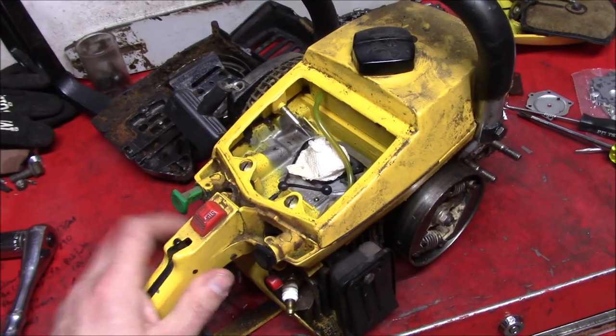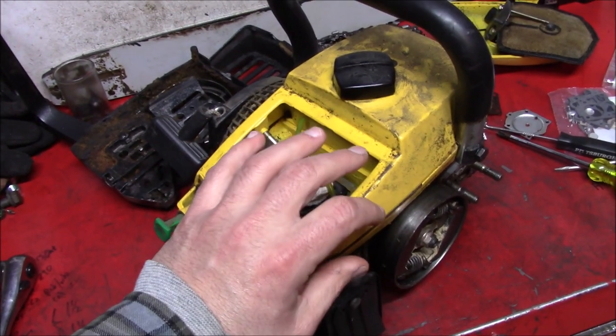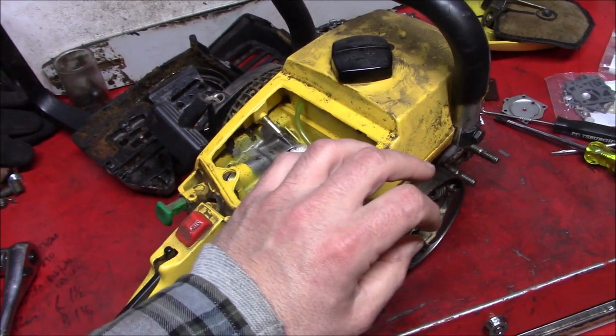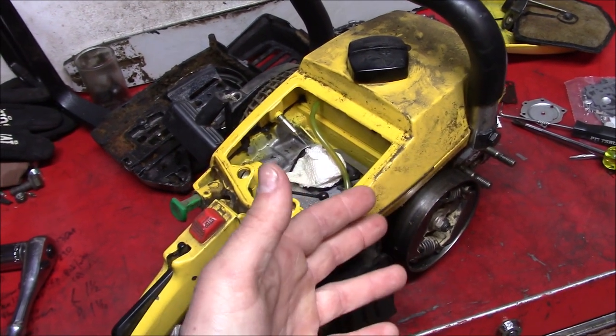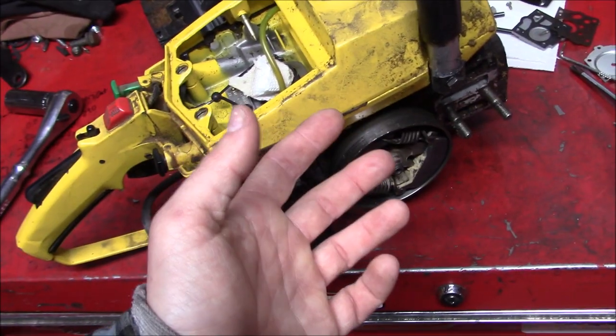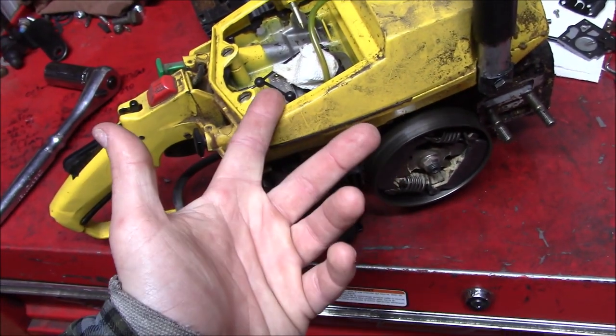And bad crank seals aren't a death sentence for any motor, but you definitely got to give the bearings a closer once over, especially if dirt's been getting sucked in through there. It could also be an indicator of just a lot of hours or miles. And running it out lean with a bad crank seal could end up scuffing your piston too.